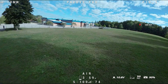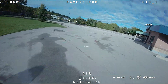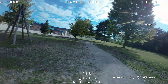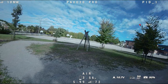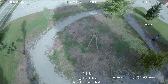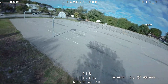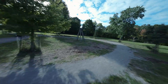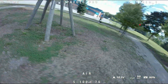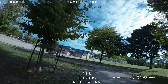We're two minutes and 30 seconds in. Usually at this point I'd bring the quad back, and the battery is getting to 3.6 volts per cell — a little lower than I usually like. But I think with this quad we can do a couple of low speed maneuvers. Let me try to squeeze in between this teepee thing — almost. It seems quite durable; I've been durability testing it. At 3.47 volts let's bring her in.